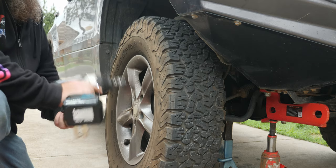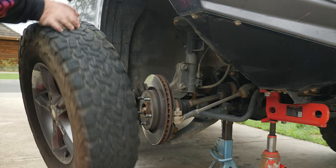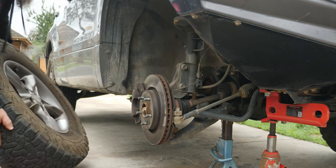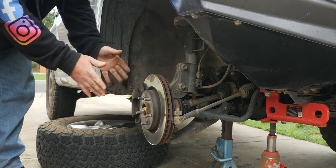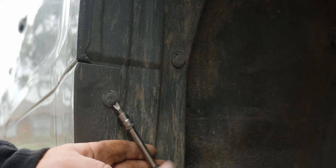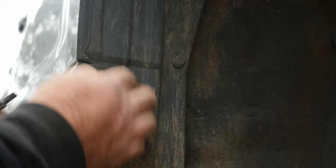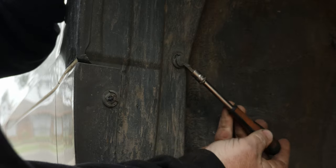Love the impact wrench for this. We'll grab a screwdriver and take out the inner guard. Of course our spare tire goes underneath — because you never fully trust a jack stand. Undo these clips: get a screwdriver in behind them and give them a bit of a twist. Broke one — I'll have to replace that. Let's try this one — there we go, that's how it's supposed to work.